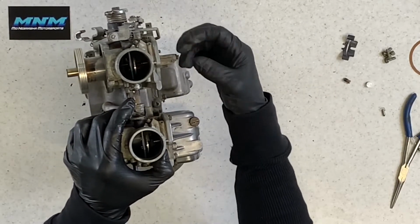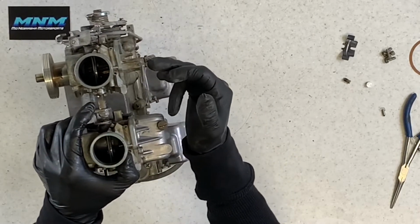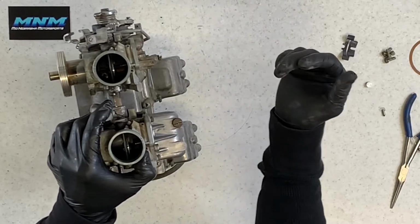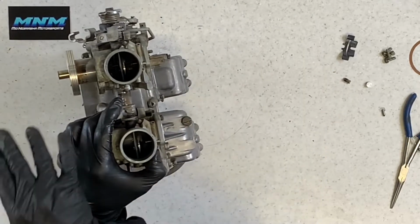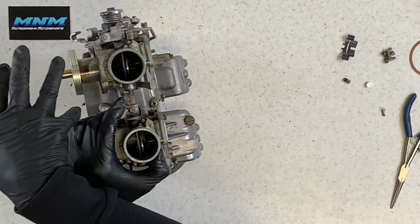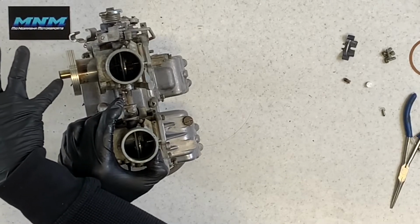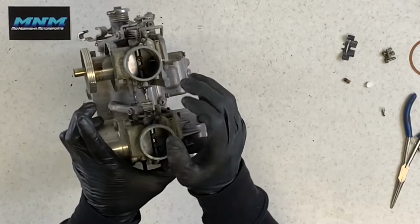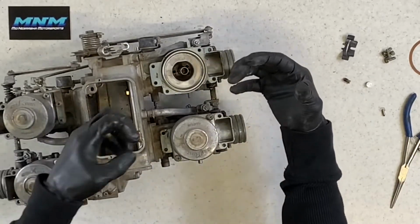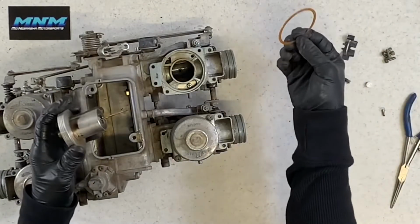If you've got exhaust pipes on your bike, if you've got an air filter on your bike, you're going to want to adjust that main jet to a larger orifice so that more fuel will flow through there. That's not going to change when that fuel hits. That's going to be determined by your needle. I hope that makes sense. If you've got questions on that, let me know. It's a little bit hard to explain because there's several different things going on at once, but I just wanted to give you a general idea.